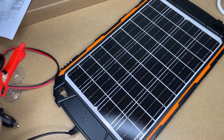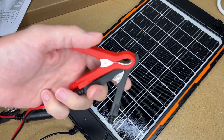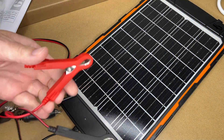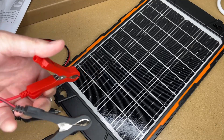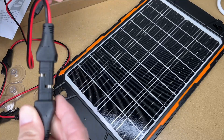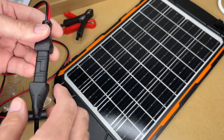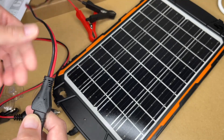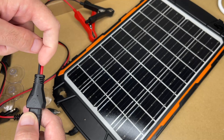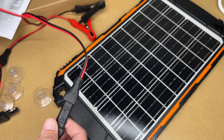Looking at the accessories, you'll add a little bit of length when you plug one in. We have battery clamps that open up nice and wide, and that connector plugs into the SAE port. If you're looking at other accessories, the polarity is not marked on this SAE connector, but you can look at the cables that came with it, compare the polarity of those to your other accessories, or just measure it with a meter.